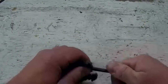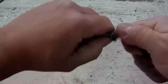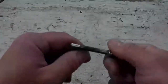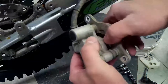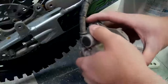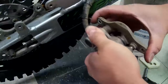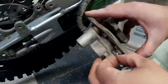I like to take our pins and just clean them off with some steel wool. If these are all pitted and messed up you might want to replace them. Before you get to putting your caliper back together, just make sure your caliper slides move and they're not bound up. If they are, they sell rebuild kits where you can get new boots and new caliper slides so that these move freely. These ones are okay — a little tighter than I like but they're gonna work just fine.